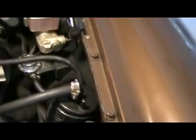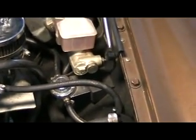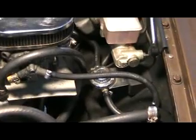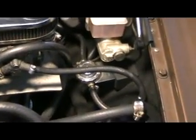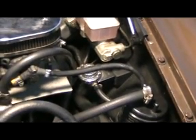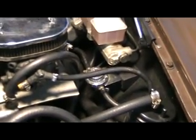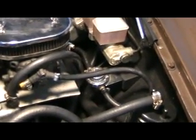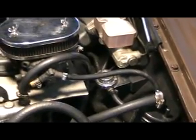That's what that regulator is all about, and I really advise putting it on there. That's what the fuel pressure gauge does. Now accompanying that, I put on a switch to control the fuel pump, and I think that's a heck of a good idea. Time and again you're working on the engine, pulling wires or looking at fuses or handling tools — you may create a spark or two. It's so convenient to flip that switch and turn the fuel pump off and know that it isn't going to be feeding any fuel into your engine compartment. I put the switch right in the column just near the ignition key entrance.